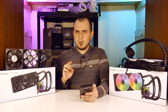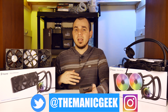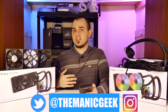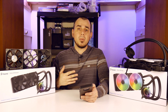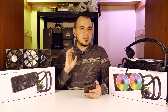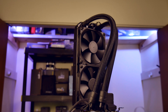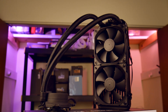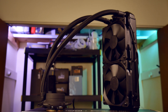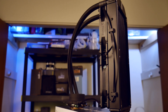It's worth noting that the Prisma fans are actually able to hold their own on the S24 all-in-one at 50% RPM with the overclocked 2600 we used. However, the Venturi fans were not able to pass all three rounds of stress testing and did wind up tripping thermal protections on my motherboard. For something like a 2600 or 3600 CPU, if you've got any sort of decent overclock going or want XFR and PBO to do their thing efficiently, I wouldn't spend on anything more than the S24 lineup. Much beyond that, you're basically just paying for lower noise operation.